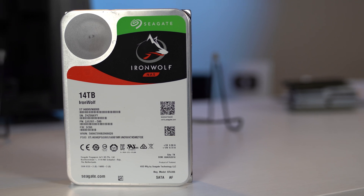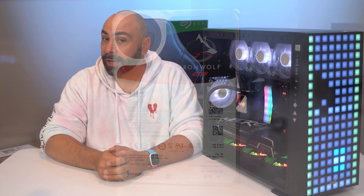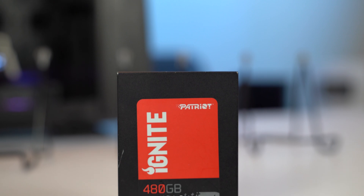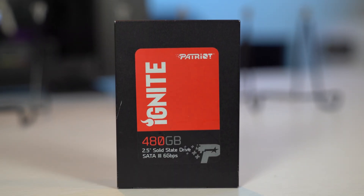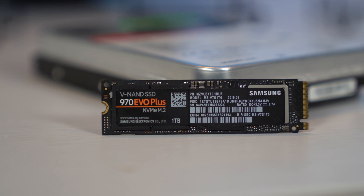We're going to move on now to the place where your data is actually stored. Traditionally, hard drives have been used for this purpose and they are still very prevalent today. Hard drives use a physical spinning disk inside of a metal housing, and because they've been around forever and manufacturing has improved over time, this is often the cheapest way to get a large amount of storage space, measured most commonly in gigabytes or terabytes. A terabyte is 1,000 gigabytes and a one-terabyte hard drive is pretty cheap these days. More recently, solid-state drives or SSDs have taken over due to their smaller size, better power efficiency, lack of moving parts, and especially their speed. SSDs are available in either a version that looks like a shrunken hard drive or in a tiny package resembling a stick of gum, but either way they will be more expensive than a hard drive when measured in price per gigabyte.